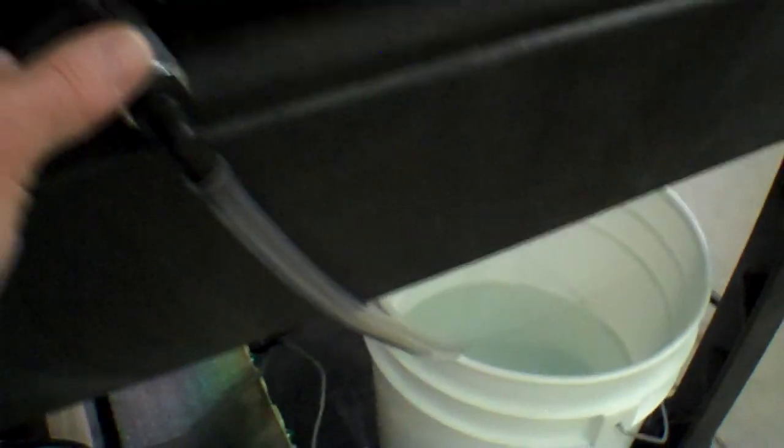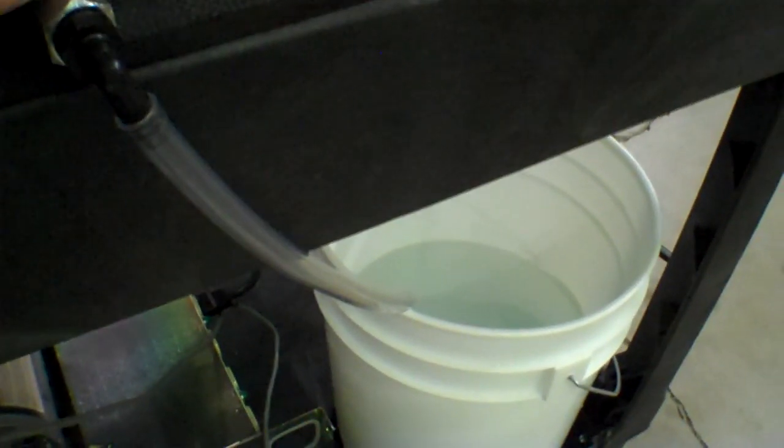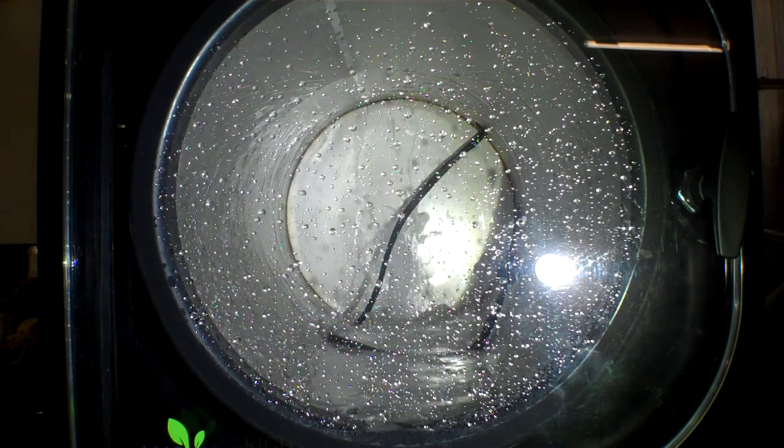So normally you'd come over here to open your valve. I'm going to angle this a little bit so you can see what happens in this hose. And here we go. You hear that? We just had water shooting on into our chamber. That's probably enough — let me just close that. But you can see what a disaster this has just caused. That water has sprayed and gotten on all of your dried food in there, which means you have to rerun the batch.